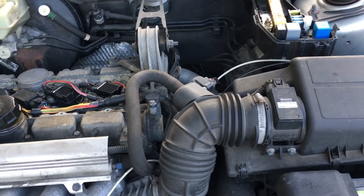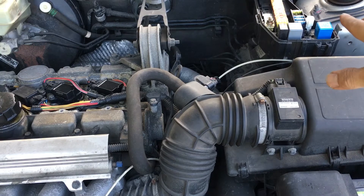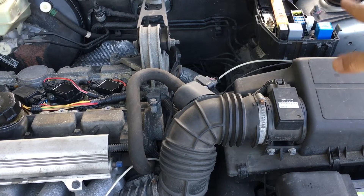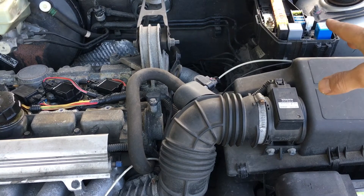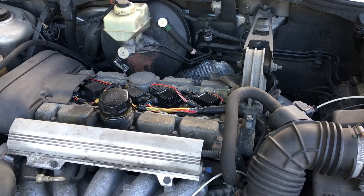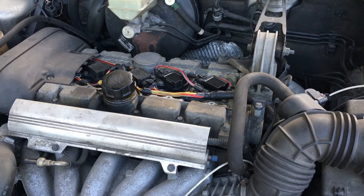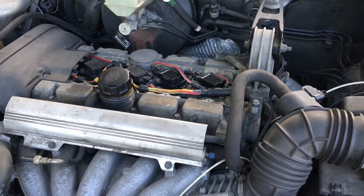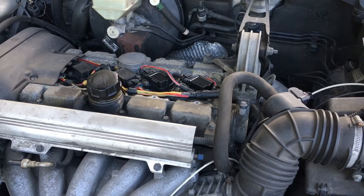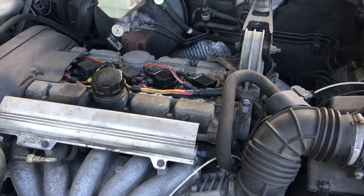What we've done here is we've taken out the fuel pump injector and the ignition coil fuse — on this car it all happens to be in one — so we've taken that out. Hopefully we're going to be able to crank the engine round without it starting. So initially we're just going to do it on the engine as it is, to hopefully demonstrate to you the sound of a healthy crank.